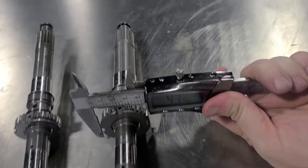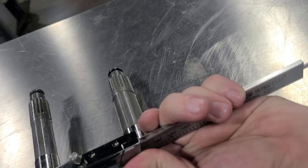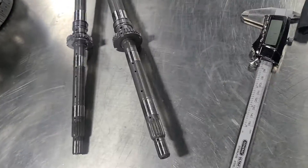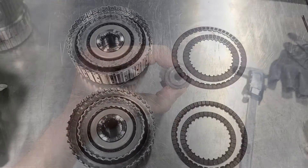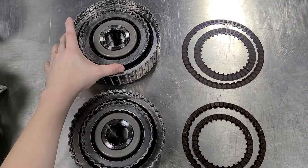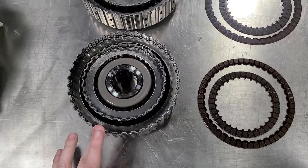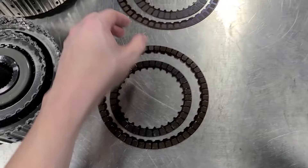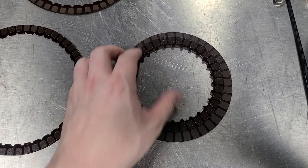Looking at the low and high clutch hub, there's quite a bit of difference between the two in the parts that really matter. They are both hollow. These are the input clutches — naturally aspirated versus turbo. The size is quite a bit different. There are still five low clutches and five high clutches for both, but you can see the high clutches on the turbo are significantly larger than the high clutches on the NA.